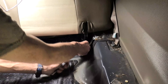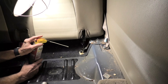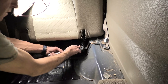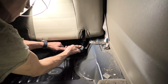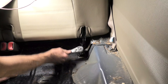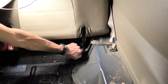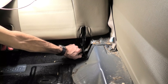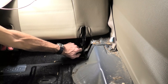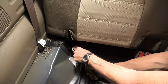If you notice, these are pretty tight. I believe they are 15mm head — at least on this one. I'd like to spray it, but as far as spraying it underneath you can't access it. It sits up in a subframe welded to the floor of the Explorer. But that little bit of PB Blaster working down in is helping. And finally, mission accomplished — it's out. So we'll proceed and do the one on the right side now.